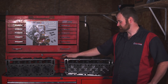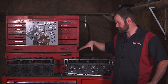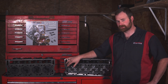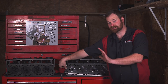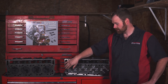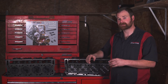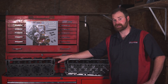PowerDriven just released a new product — we've been working on these heads for a little while. These are our new 6.0 PowerStroke heads, and they come with 20-millimeter dowels. One of the benefits of the 20-millimeter doweled heads is that the bed plate seating surface that mates to the block is physically thicker than the 18-millimeter doweled heads. It'll help eliminate a lot of those cracking issues around the exhaust and intake dowels, allows for a better sealing surface, and won't warp or deflect like the 18-millimeter dowel heads can.